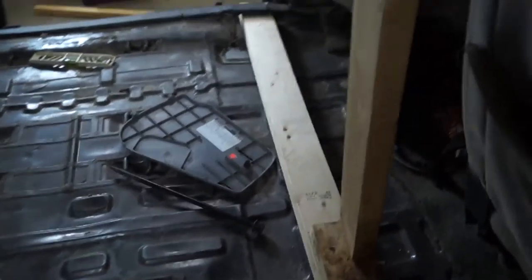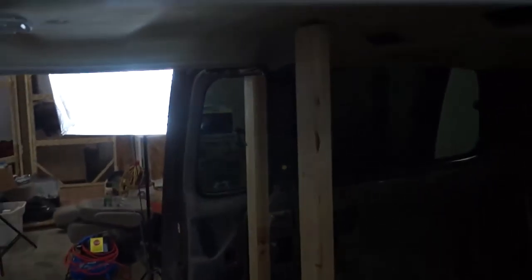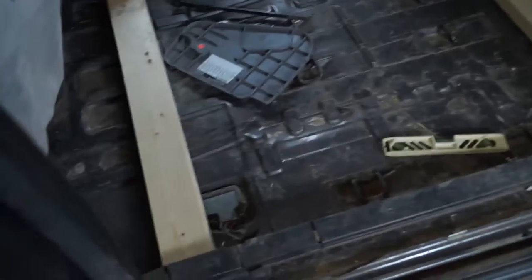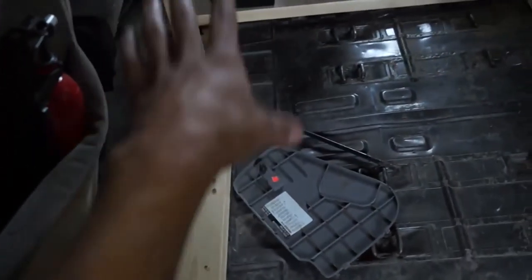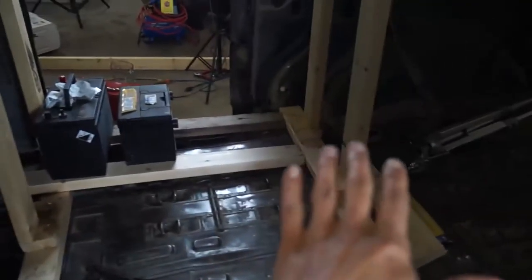I've made some progress, as you can see. It's not as much as I would like. A lot of challenges in trying to actually make things work in the van. What I've started with is the computer workstation. I've got a lot of work to get this all finished, but the hard part was figuring out exactly how to put this in the van. There's a lot of challenges with that because there's movement every which way. So while this is going to be down to the floor right here, what I've decided to do is run two by fours flat to put the maximum amount of force over the most area for the weight of this, as well as I went edge to edge to give it bracing for moving side to side overall.